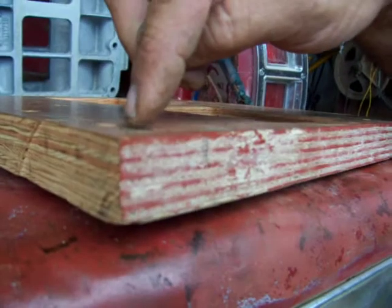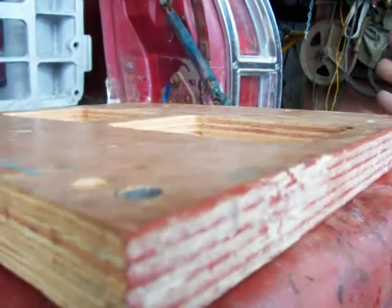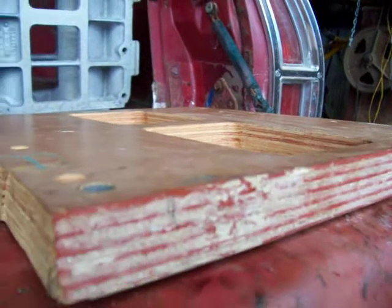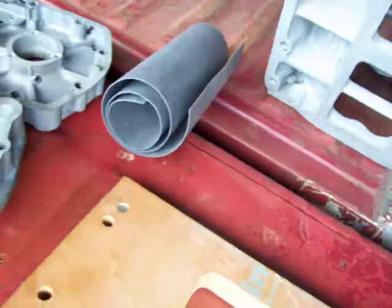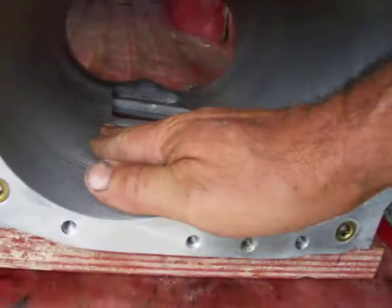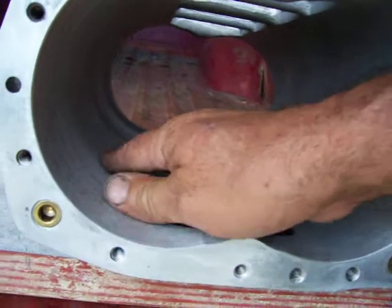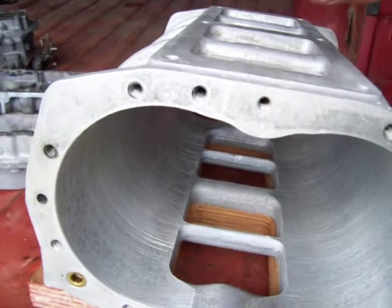With our gasket thickness and plywood thickness, it's five thousandths shy of crushing here to your bore point. These bolts don't torque down very tight — I'll torque them to probably 10 pounds. BDS torques them to 12; I torqued the Detroit to 55 pounds. But on these blowers with aluminum intakes, you can't torque them down big time because it'll distort it. If you distort this just a few thousandths of an inch, you're going to be hitting your rotors. When I put this back together I might check that with notebook paper — notebook paper is about three and a half thousandths.